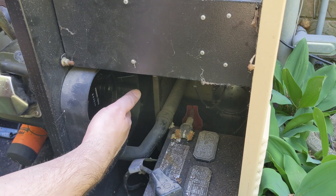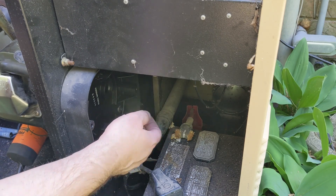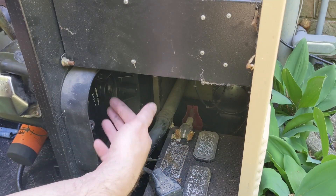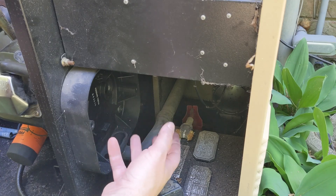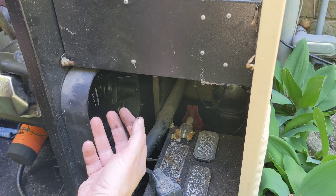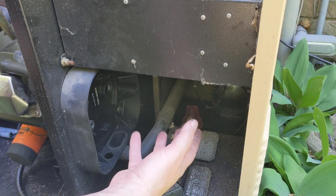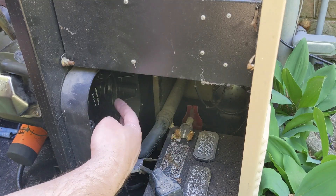Basically, what it'll do is richen the mixture. We're going to change the air-fuel ratio to see if that changes how it behaves. If it starts right up when I'm partially blocking it, that means it's running too lean and we can look in that direction. We'll also just smell for the gas smell to see if fuel is coming in. Obviously, it doesn't tell us if it's the correct pressure, but if we at least smell gas, we know fuel is coming in. If I don't smell anything, then we need to work backward and look at the regulator and the solenoid to see if fuel isn't getting here. The easiest thing to do is start right here and take a look.